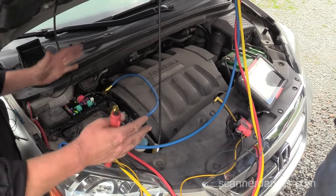I'm doing the test with my switch — we know our power is getting down there. I can't really check that ground easily. I need to show it to you — I'm going to hook those two leads. It's a case where you do not have a choice: you have to poke a hole in a wire. Small hole — we'll fix it with a little bit of liquid electrical tape made by Permatex, about five bucks.